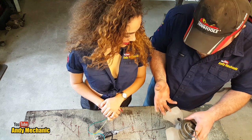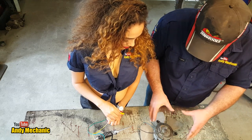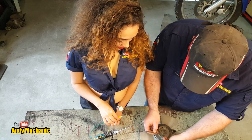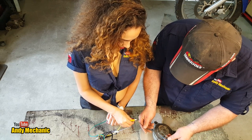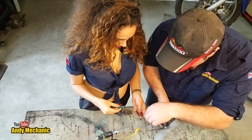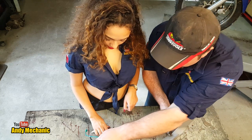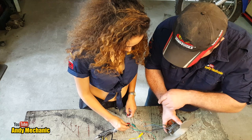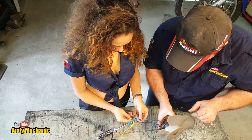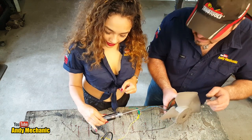We've got an unknown — customer complaint, the fan doesn't work, so we want to test the fan motor. Now this one has four wires going in, so it's obviously got two sets of windings. It might be a fan that does low speed and high speed. I just found it in the bin, so we'll see what's going on. Connect the earth to there — cool. I'm going to hold the fan while I turn it. Connect one end of your wire on the test light and put the other end on the blue wire first. I don't know which is slow and which is fast — we will find out. We've got a test light lit up. Hold the test light up so the people can see it, and they're going to watch the test light as I rotate the fan.